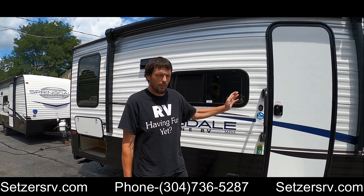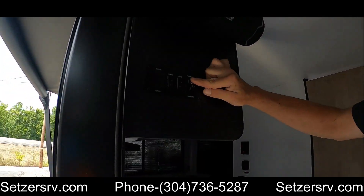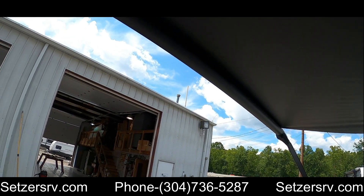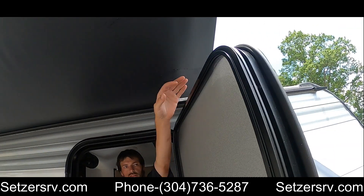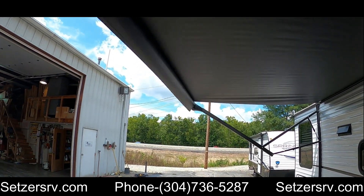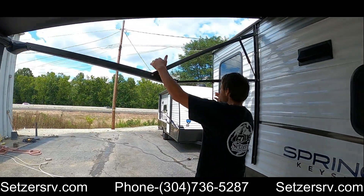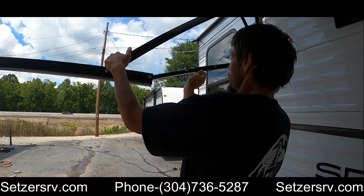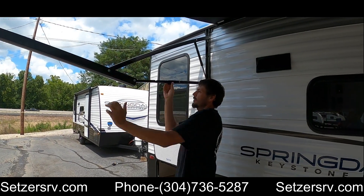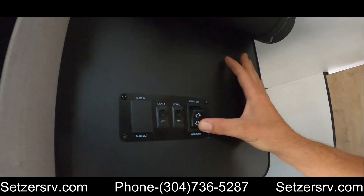That's almost everything on the outside — I'm just going to go in and let the awning out. Hold up on the awning switch right inside the entrance door. Make sure the entrance door isn't interfering with the awning arm. You also don't want to over-extend the awning. If you need to pitch it further down, tighten this little thumb nut after you pull down. I always recommend putting it back up before putting the awning away — just press and hold down.